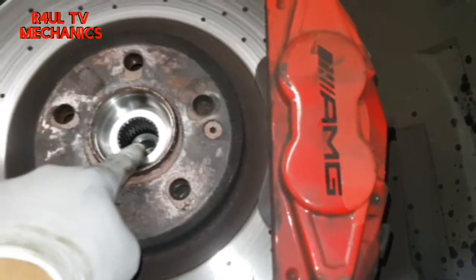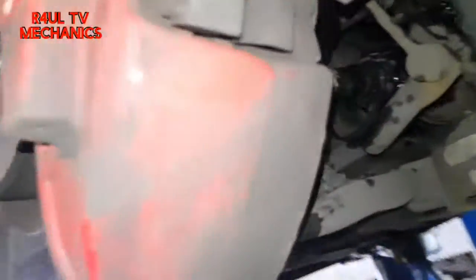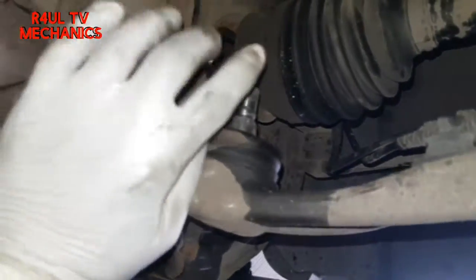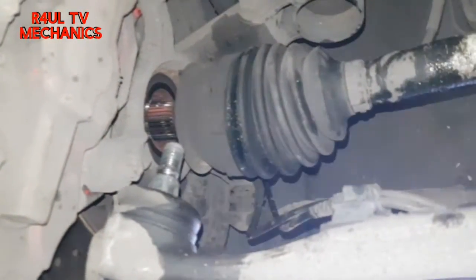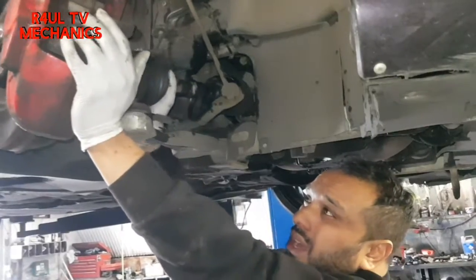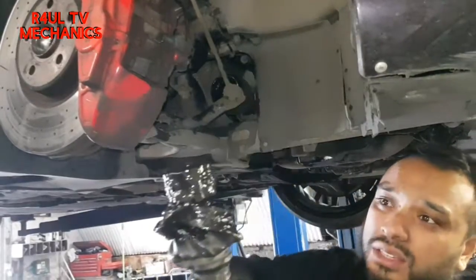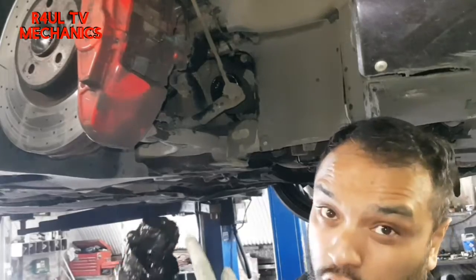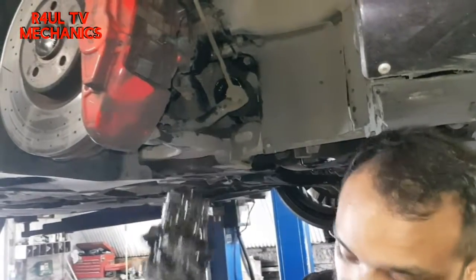What we're going to do now — the CV joint has gone inside, the drive shaft has gone inside, so I'm going to push the hub out of the way and take the drive shaft off. This is absolutely gone, as you can see — it's all dead. The drive shaft itself is all right, but it's the inner joint that's collapsed. Been doing some handbrake turns, haven't you?